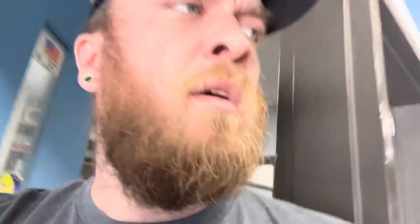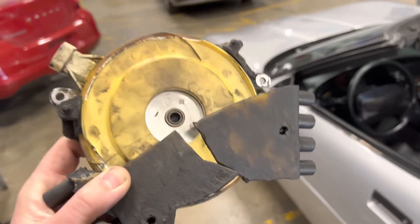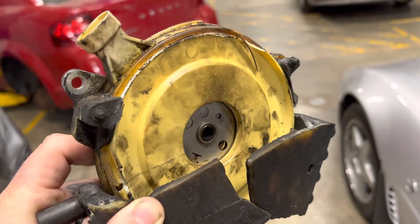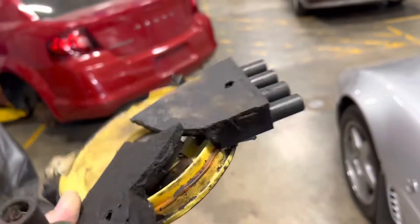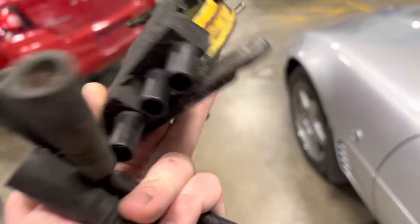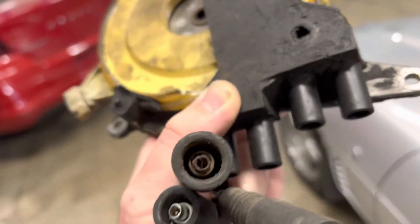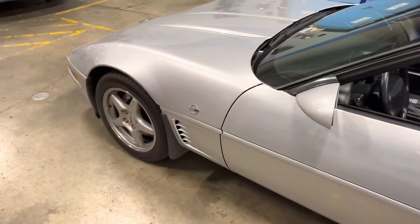It's about a week later. I got these parts in my office here. Let me show you what a couple of the worst plug wires look like from the OptiSpark. That's what the OptiSpark looked like — gotta be the original. I broke it taking it off because I was prying against it, but the rotor was just kind of dangling in there. And obviously the corrosion at the spark plug terminals. Those two spark plug wires were full of water — just junk.